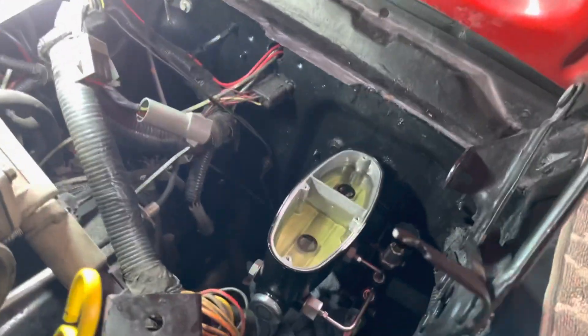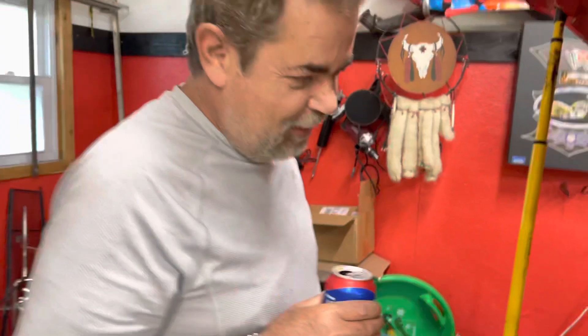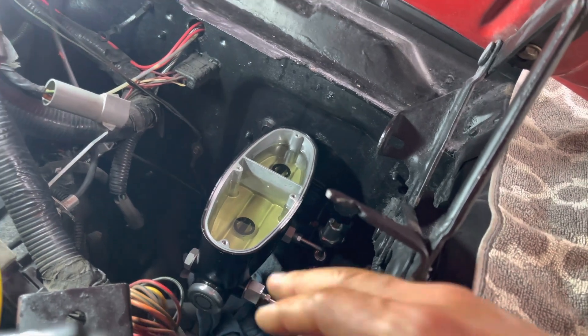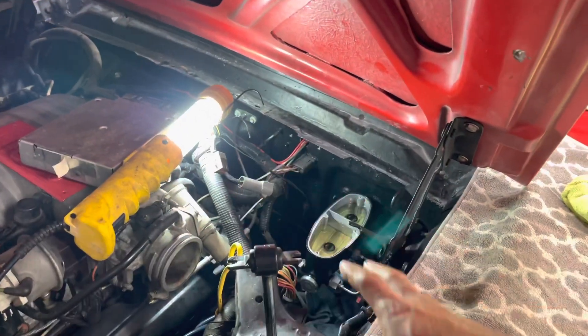It's the next morning — we've been working on this for about 45 minutes and we've finally got the mechanicals on the master cylinder pretty much wrapped up. Getting these lines to work with the distribution block was a real pain. What we ended up doing was loosening the master cylinder and the two screws holding the distribution block, then just kind of wiggling everything until it lined up. Anyway, it should be good now so we can button up the top.